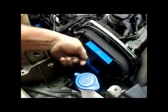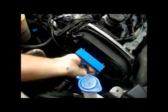This special tool held the gears in place until he put the belt on. We'll see if we can show you the timing marks on the top side. It's going to be difficult to see on video, but there are two marks — there's a mark on the cam and a mark behind here that's got a red dimple that sticks out. Those are lined up on these two cams.